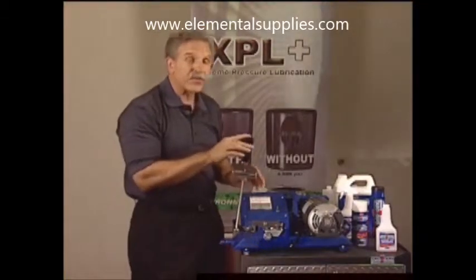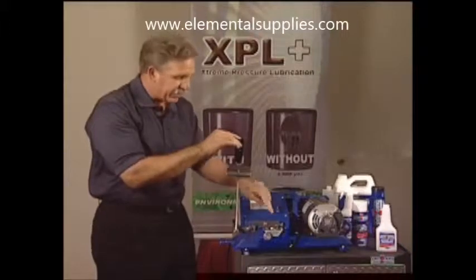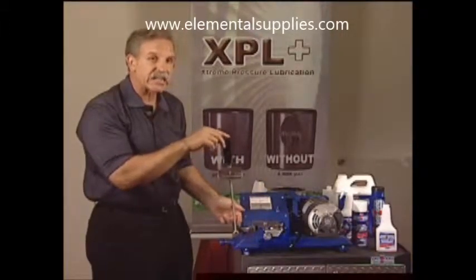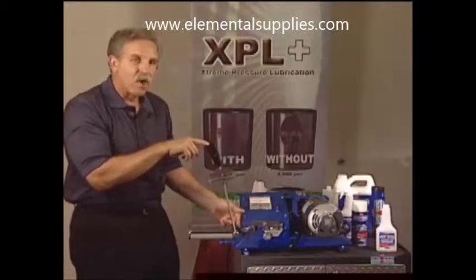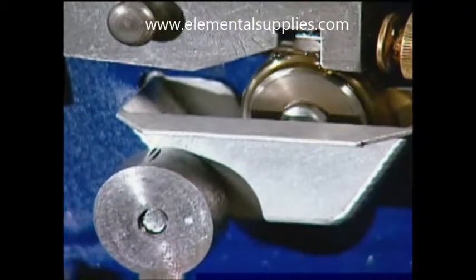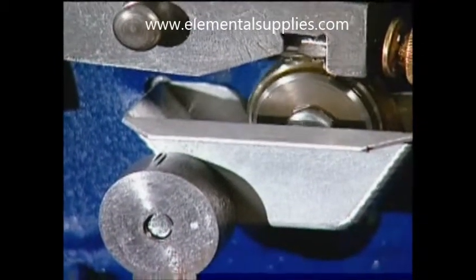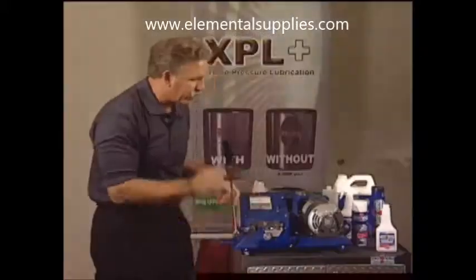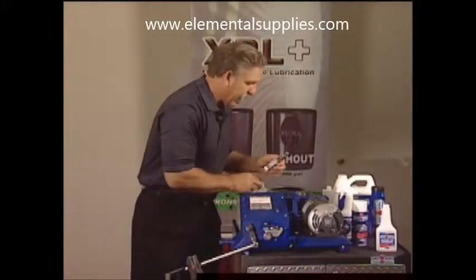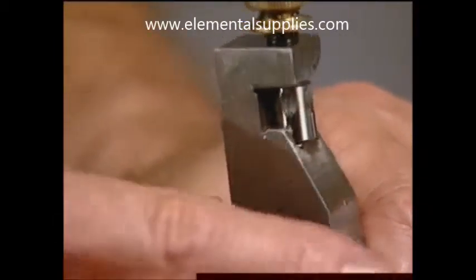This product has well over 300 degrees — about 325 degrees. I'm going to run it 7 seconds. As you can see smoke coming out of the bearing, it will be inside that 7 seconds again with a finger full of pressure. 1,001, 1,002, 1,003, 4, 5, 6, and 7 — you can see all that smoke coming off the bearing. Very, very similar to what you'd see with the synthetic product, which is also a real good product.